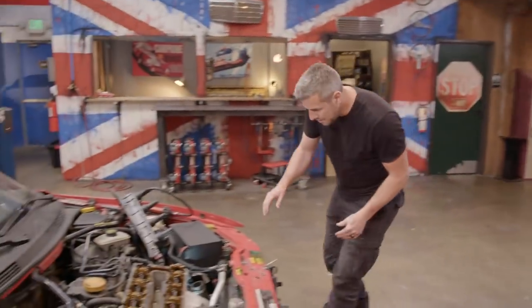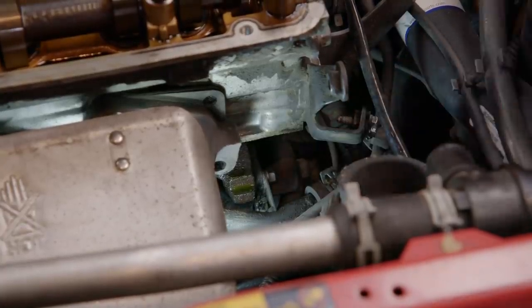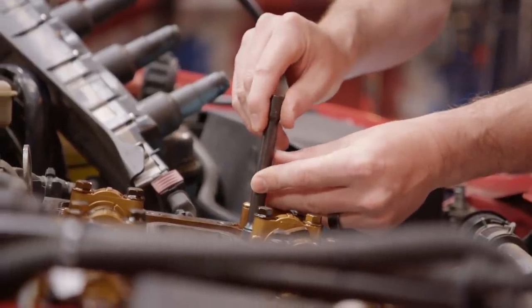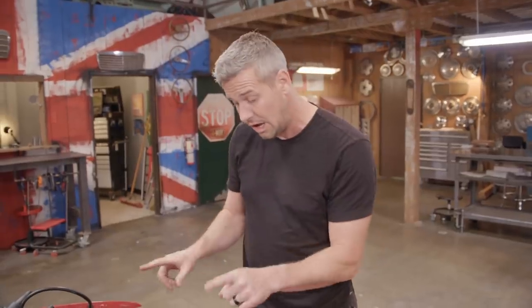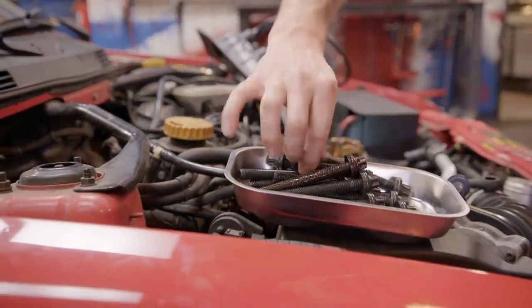Now that the engine's all open, I get a better look at what's going on. The leak is definitely coming from between the block — the darker metal — and the head — the aluminium. Now, before I go any further, there is a curious anomaly with this particular engine, especially on that front corner. Placing this on that head bolt on the corner — look at that — the head bolt is finger tight. It's really, really loose. This engine, the 9.3, is exactly the same as the 9.5, and up to a certain year — which happens to be 2001, the year of our car — this engine had a problem. Saab on the factory floor fitted those head bolts with an anti-friction paste and wax, and because of that they have a tendency to work loose. These new bolts are called Torque to Yield, or TTY for short — they're actually designed to stretch. So I plan to swap out the old bolts for the nice new stretchy ones.